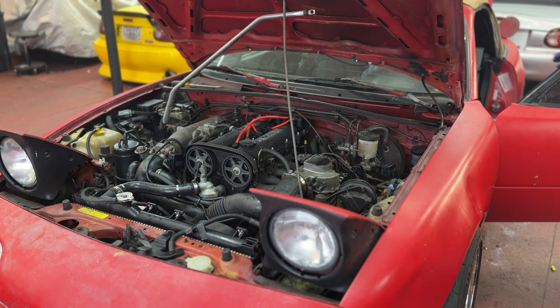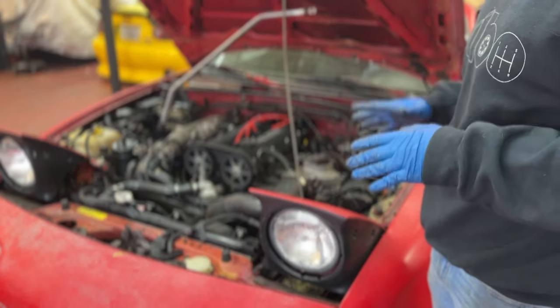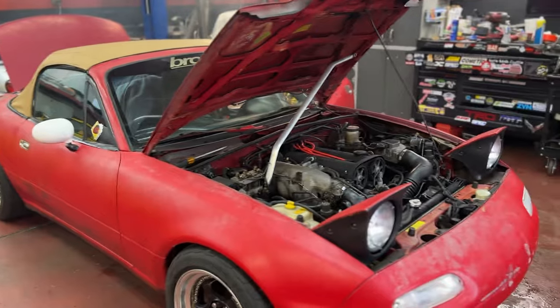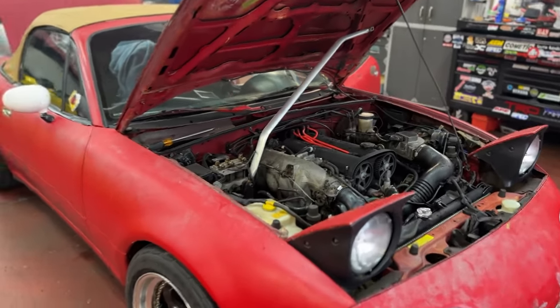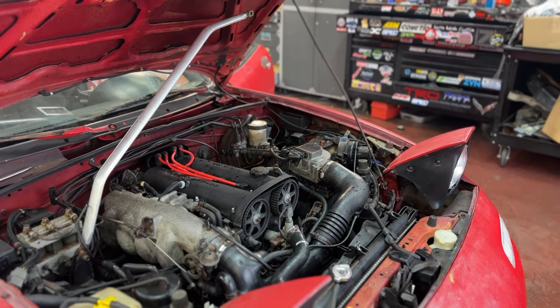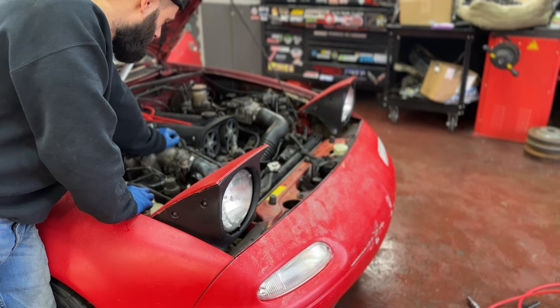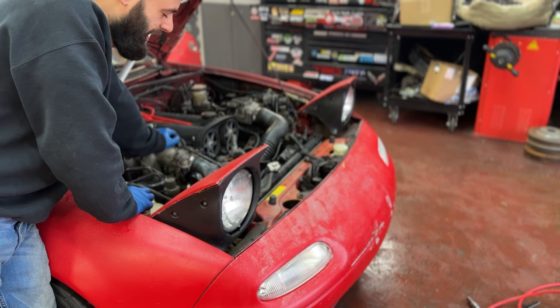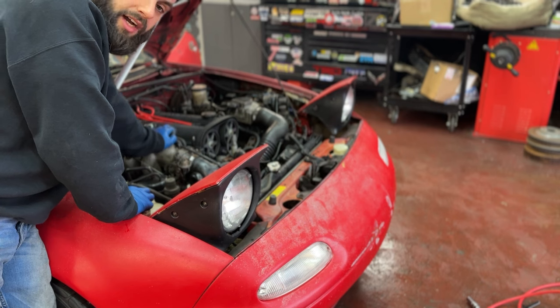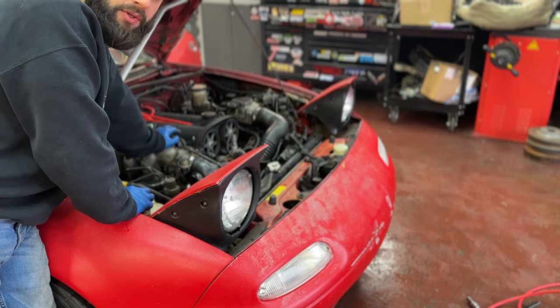He's always run like this. He runs really, really poorly, and I gotta figure out why. Not good, but he is running again, which is good. So, what I'm gonna do is I wanna check timing. I've never checked timing on this car. I might try and wire in the fans real fast, so I can have Georgie idle and get to operating temp, and then I can do proper tests on it.